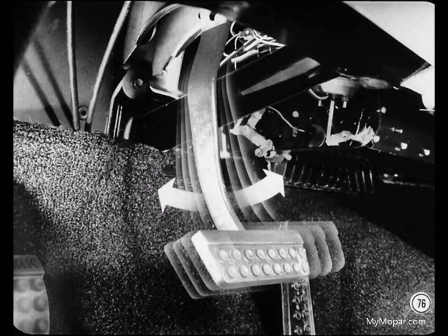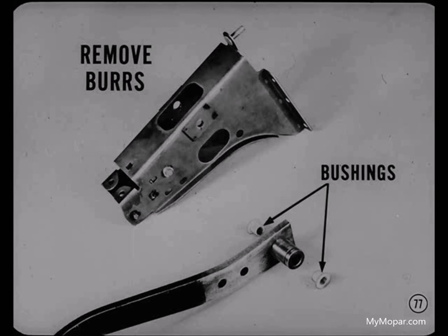When the cross bolt is removed, swing the pedal back and forth. If the pedal moves stiffly, the bracket might be slightly twisted or there might be burrs on the bracket. A rough grating feeling indicates damaged pedal pivot bushings. An extremely loose pedal means damaged bushings too. Remove any burrs from the bracket and pedal and replace any damaged bushings to correct the problem. Then lubricate the bushings and install the pedal in the bracket so you can retest it.